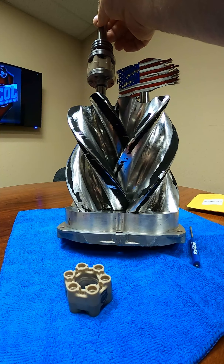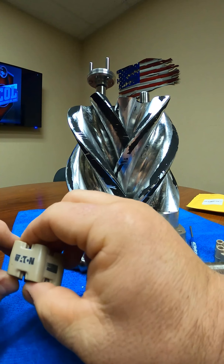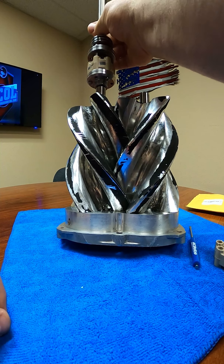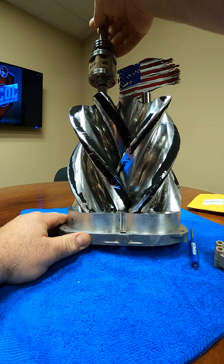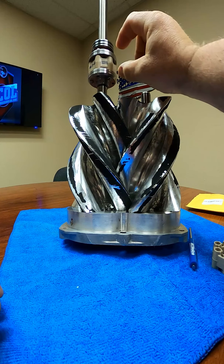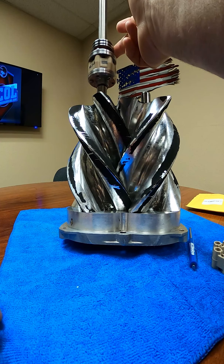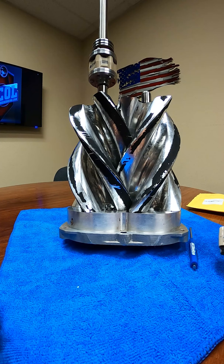This is nothing but noise when your vehicle is running — and it's amplified ten times over in your vehicle. So when you take the Chinese part off and put on your Eaton original part, push it down in here and give it a good push on, then push your shaft on — you can see how tight it is to get it in there. The connection is solid, and that's what you want. When you get deviation between these two and lateral movement, you put wear on the housing bearing right here and your rear bearing and nose drive — some people call it the snout. That's going to put unreasonable load on either of those bearings, and that's where you get bearing failure from a bad part.